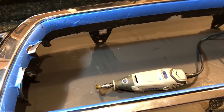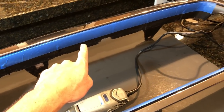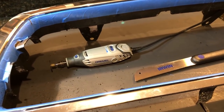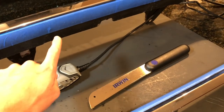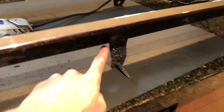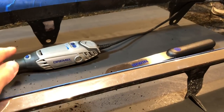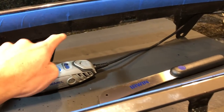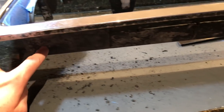To make the cut along the edge, we're going to use this Dremel and go along the edge of the blue tape. We started with a Dremel tool, but found it was a lot easier and faster using the saw to cut through the sections we could. The areas we had to be careful with were areas like this and the square areas up here where the brackets are. We used the Dremel for the more delicate areas, and then once past those, used the saw along the line — it went a lot faster.